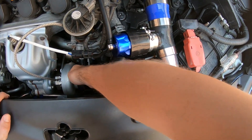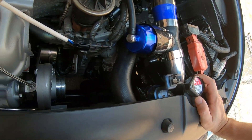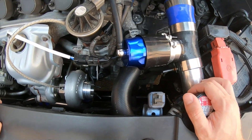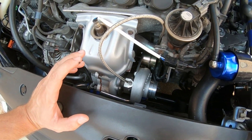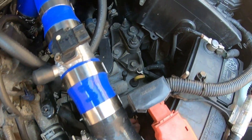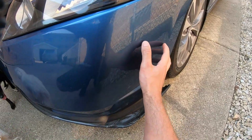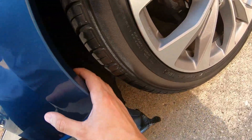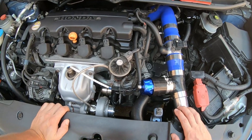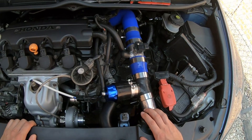After installing the turbo kit, this is what you're looking at — just the open turbo inlet with no piping whatsoever. It's kind of tight in here to put an intake on, but it is doable with a two-inch pipe, which is what our intercooler piping is. Ideally, for best performance, you want to route a pipe around here, under the battery tray right where your factory intake is — or a cold air intake box — between the bumper and fender liner. That's your best spot for cool intake air temperatures. The cooler the air temperatures, the more power you get, less pre-ignition, less knocking.